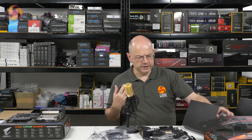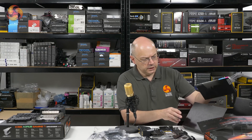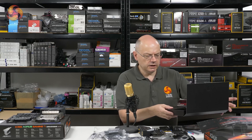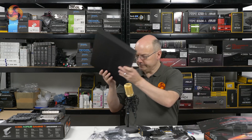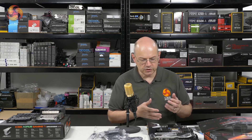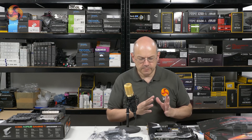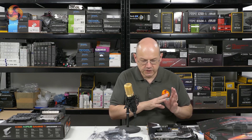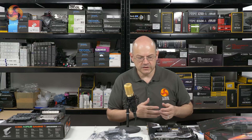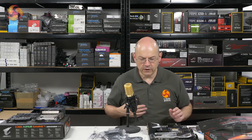The thing about the accessories here is that the move from the 180-watt TDP Threadrippers to the 250-watt — the 180-watt are HEDT, high-end desktop — whereas the new 250-watt are a different category. They're essentially workstation boards, but AMD is stretching the definition of high-end desktop to include this workstation territory, because it's the one socket that spreads across the whole gamut. You can still just about get the 8-core entry-level Threadripper all the way up to the 2nd-gen 32-core.